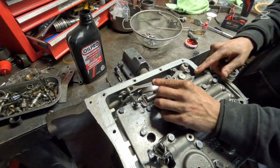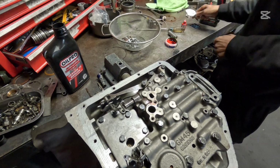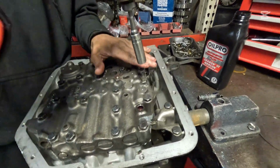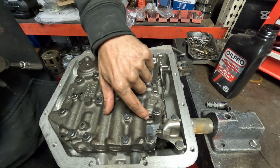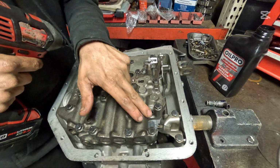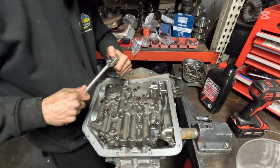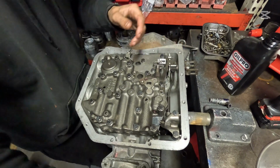And with the 3rd notch, you want to make sure that your manual valve is flush, or at least very close to flush, with the valve body. You see how that's basically flush, there's a little bit of room there, but that's no big deal. If it's pushing out a little bit further or inward, you need to adjust this rooster comb just a little bit. I'm going to tighten this down. And there's that.